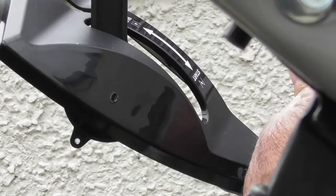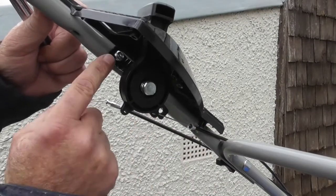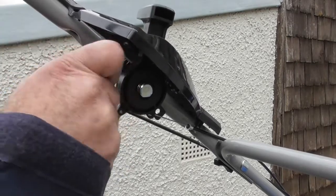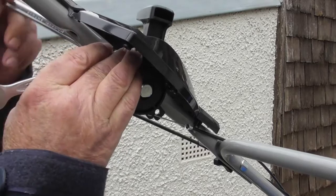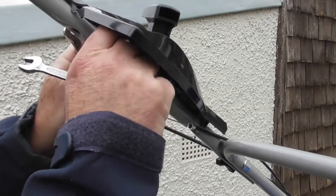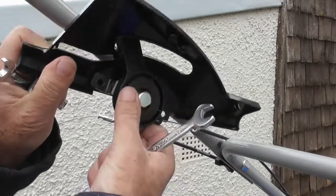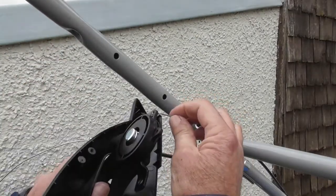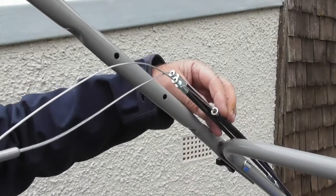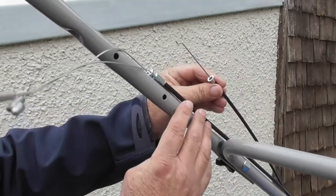The final cable up here is the choke cable, and we need to undo this bolt to release it from its holder. Again, two 10mm spanners — one on the nut, one on the bolt. With the handle released I can swivel it around and release the choke cable. So that's three cables completely released from their housings on the handlebars: the drive engagement cable, the OPC cable, and the engine choke cable.